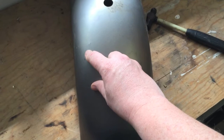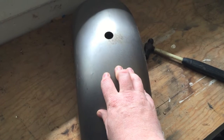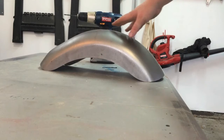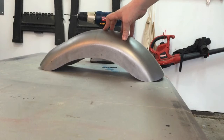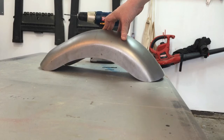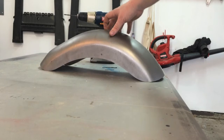Next step is we're going to have to drill to find a way to set up these side holes. We have to mount it using the top hole on the scooter and start getting lined up. We tapped the holes into the side after a test fit. Whether you're building this or anything else, make sure you test fit as often as possible. There are some issues with the fender rubbing against the body — a lot of little tweaks you have to make before you drill the hole.